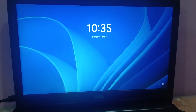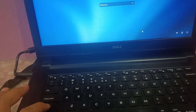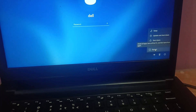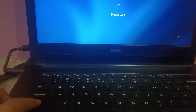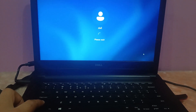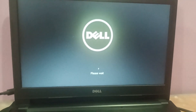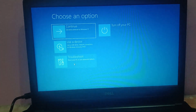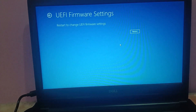This is my Windows 11 laptop. Hold the Shift key and click Restart. Keep holding the Shift key until you see the advanced recovery options screen — once you see 'Please wait', you can release it. Then click Troubleshoot, Advanced Options, UEFI Firmware Settings, and Restart.